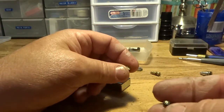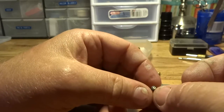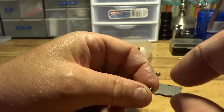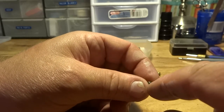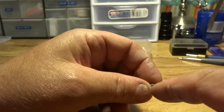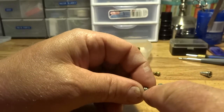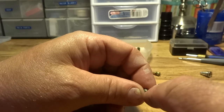Like I said, you'll get a 5x1.5 O-ring. The O-rings that come on this normally are round, but they're kind of square like a washer. But this is just a regular O-ring. It's a 5x1.5. So that's 5 millimeter diameter, 1.5 millimeter on each side of the cord here. I mean, it's 3 and 2 millimeter in the middle.